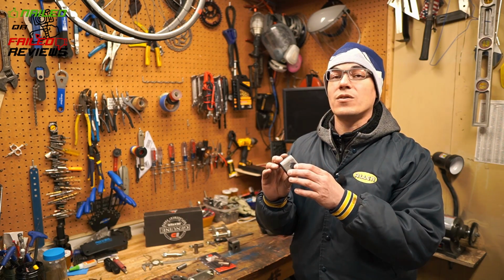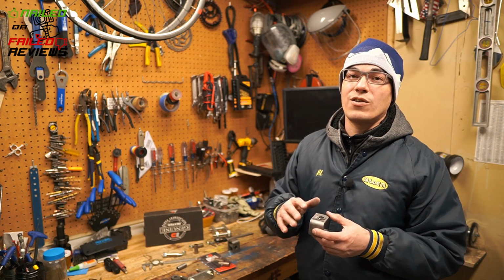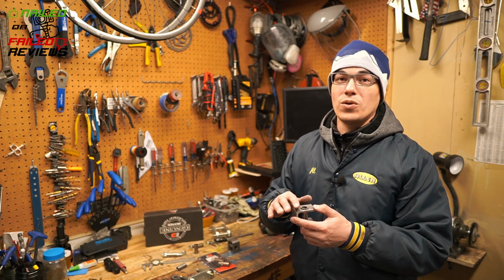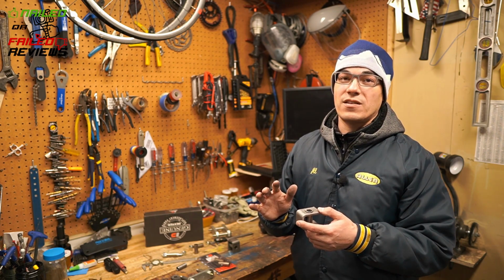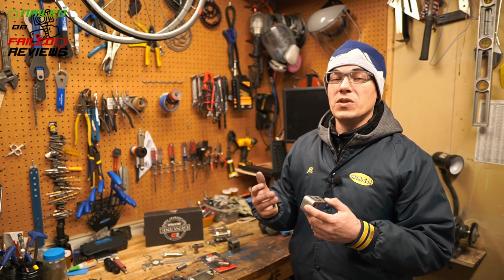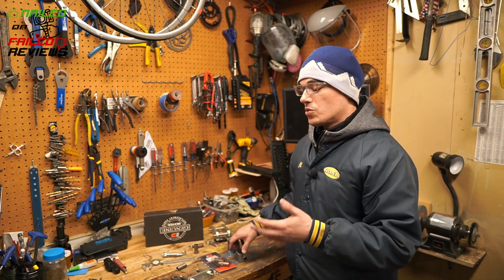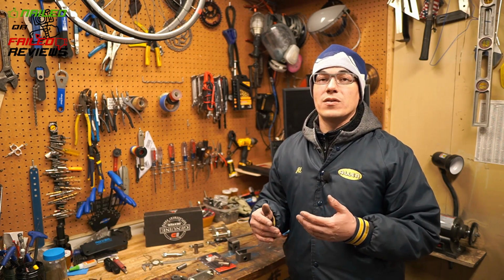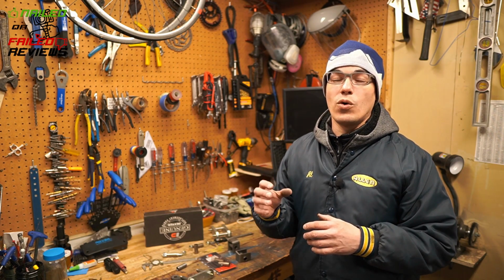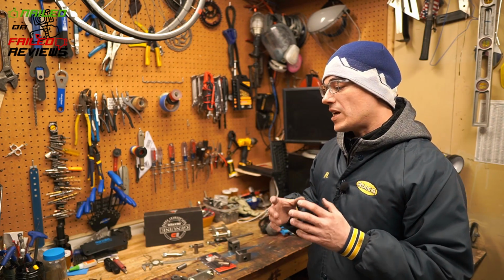Now again, one of the things that you have to consider is, depending on how far gone or how oblong your hole is. Mine wasn't too bad, luckily, and I was able to drill out the hole. The minimum was going to be 11/16, so I had to use an 11/16 drill bit to take out the minimum amount of material to make that hole completely round again from being oblong. So that's going to be your issue.